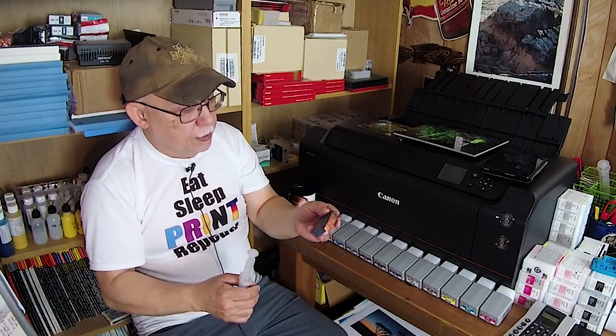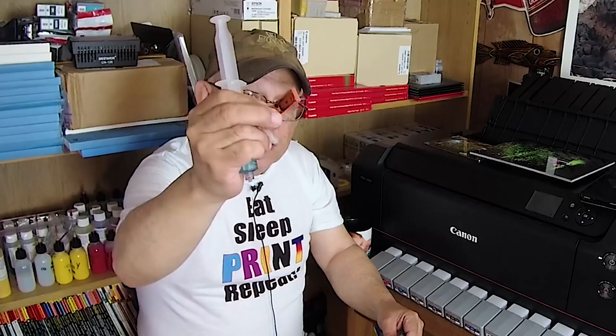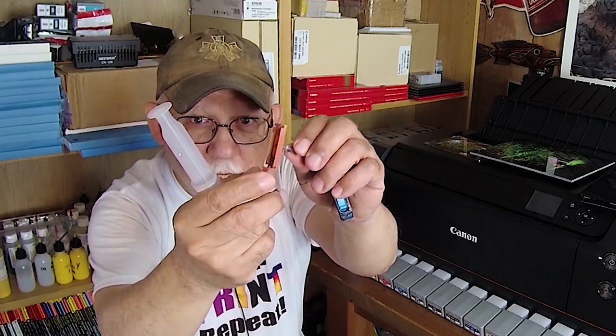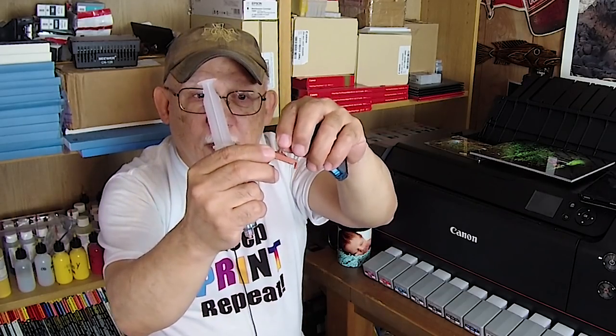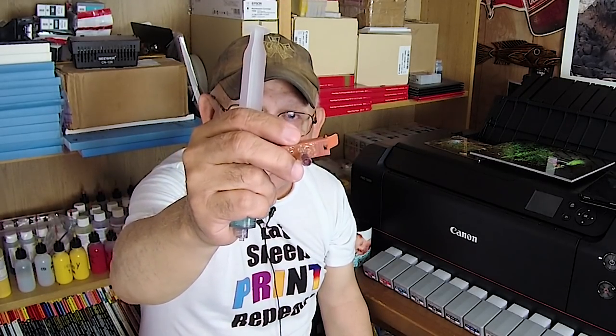What is this thing? This is one of the original clips. I went ahead and punched a little tiny hole, took a stubby needle and cut it off with a little disc cutter for a Dremel tool, made it into about an eighth of an inch long stubby needle, inserted it into the hole, and used epoxy or crazy glue to keep it in place. It's very difficult to glue to this type of plastic, so you need to put on a good amount of epoxy to keep it nice and snug.